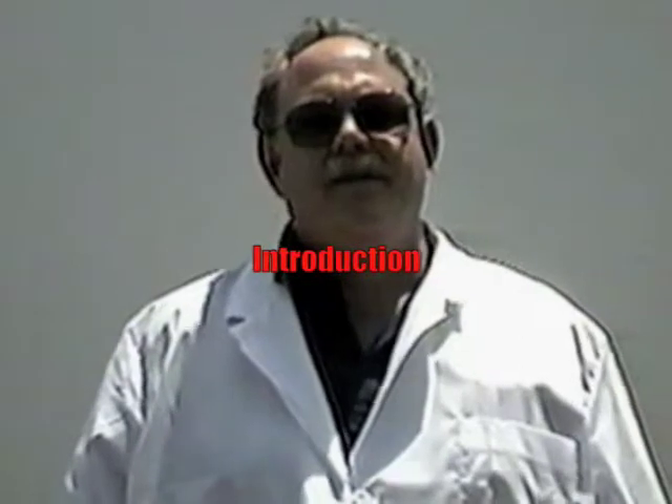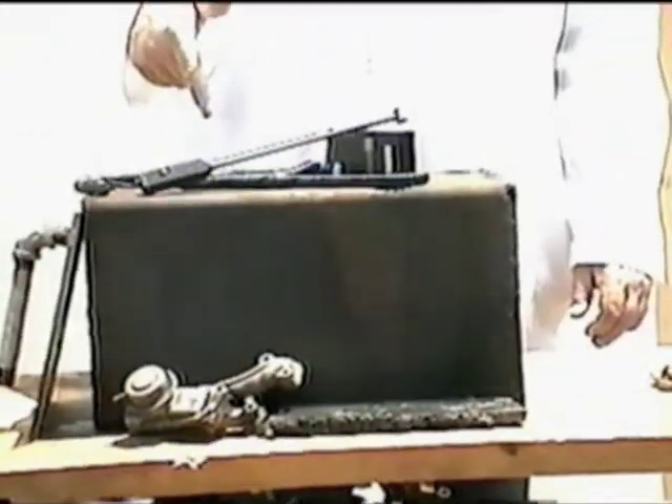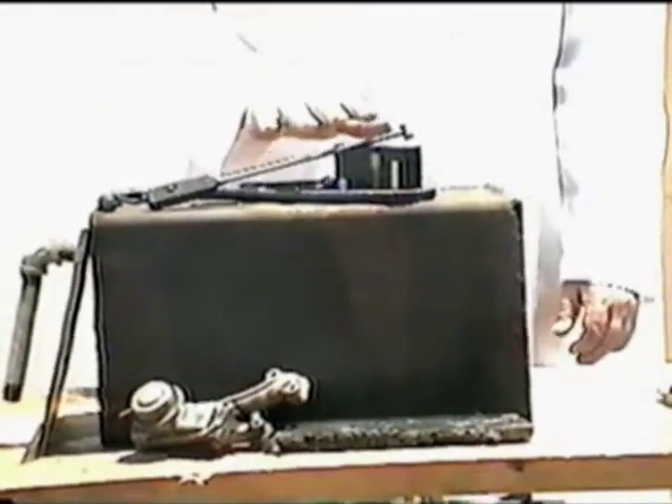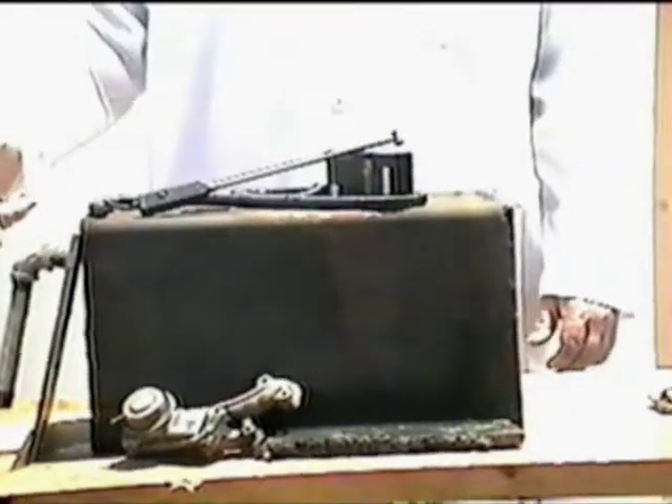Greetings. In our exercise here, what we're going to do is take some items that are commonly found underneath the hood of an automobile. We're going to destroy them one by one in our oven. I'm going to take a torch, place it upon the top of the item inside the oven through our access hole here. And at the point of destruction, I will take my pyrometer, remove the item from the oven, and measure the surface temperature. With a little bit of experience, an adjuster or special investigator should be able to see what items are normally consumed and what type of fire occurs under a hood.